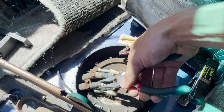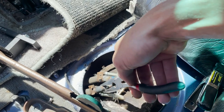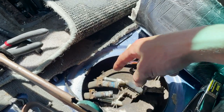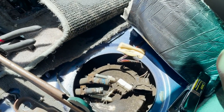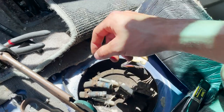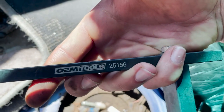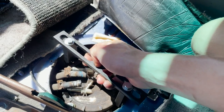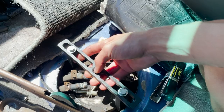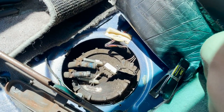I went with this pressurized line first — the one going up to the engine. You want to break it loose, get it right down to the end, and then gently let some air out. Some fuel will squirt out, so just have a rag right there. Not too much will come out. Then undo this clip and now we're ready to get the top of this off. You need this special tool — you can get it at AutoZone. It hooks on like this, you tighten these things down, and then you just take your ratchet and twist this thing off. Let's start siphoning this gas out.